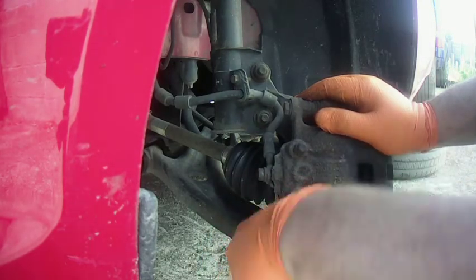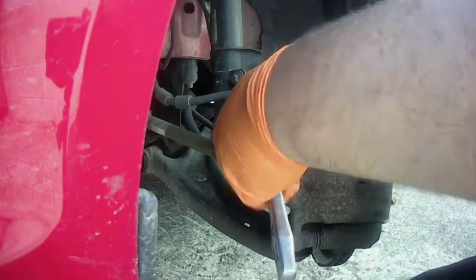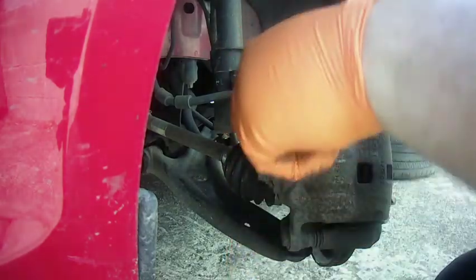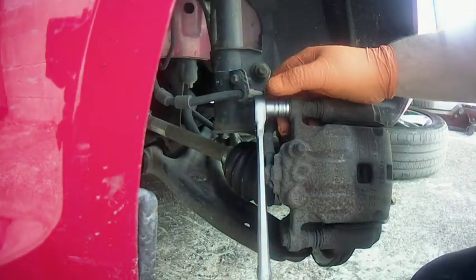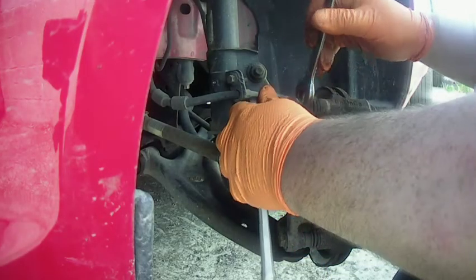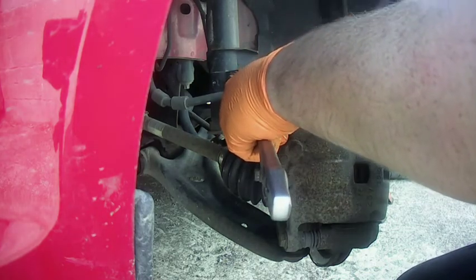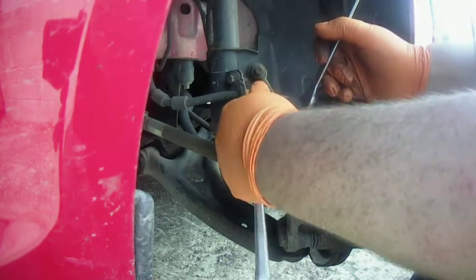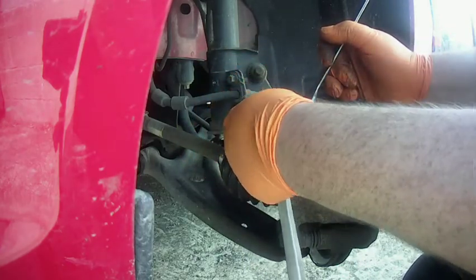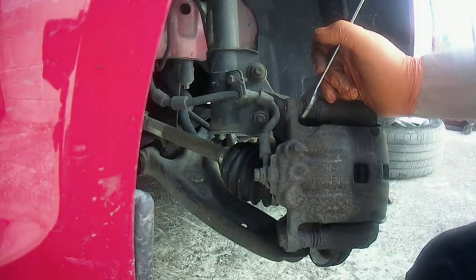You'll probably see there that the 19mm hold-on the inside is spinning. We'll crack this top one off and then we'll get a spanner. There's that one there spinning too. We'll put a spanner on these points. It's a 19mm and that stops the inner part spinning. So I'm actually moving the inner part and holding the outer part, but you can do whichever way you want. If you get the rhythm right, you can do both at the same time. I can't get the rhythm right.